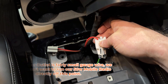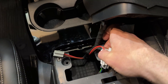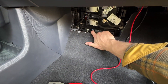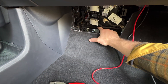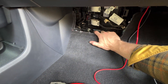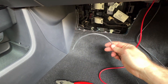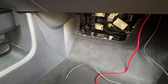What it does is, after 15 minutes of walking away from the car, it shuts the power off to the power point, and we're going to use that power fed to the power point to switch our Bosch relay. This relay has two terminals that are both powered when it's switched on, and then the back terminal — I think that's number 30 on this Bosch relay — is actually the one that you put the switched wire on. I'll put the feed back here on the back, and then this will head into the radio under the panel. This black wire is a little bit short — I wish I would have planned a little better there — but we're using the wire that came with it, so I'm going to extend this wire and that's going to go down here and then along back to the radio as well.